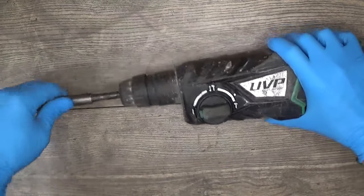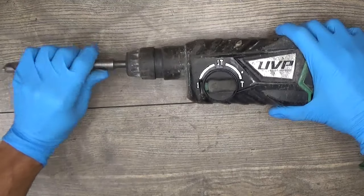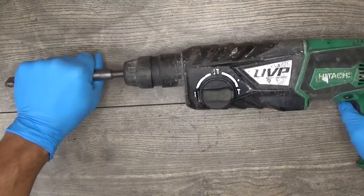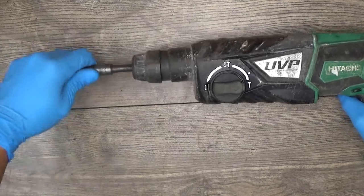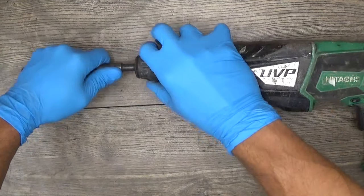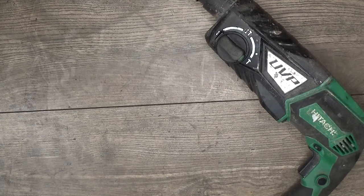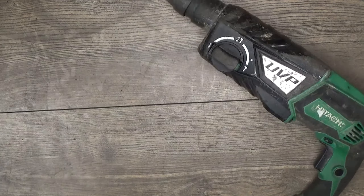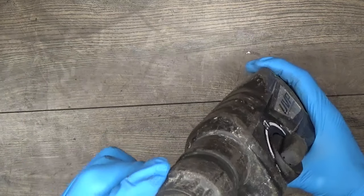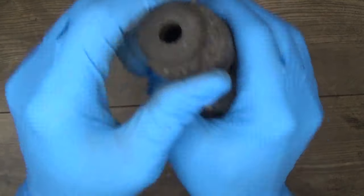I will try to insert a drill bit a little bit. It's not holding. I will check if it hammers. It hammers, but the bit is stuck. So the good part is that we know that the motor, the switch and so on is working. And I can see the problem in the tool holder — it's all clearly worn round and it needs to be replaced.